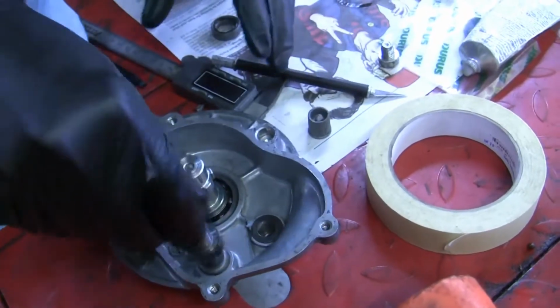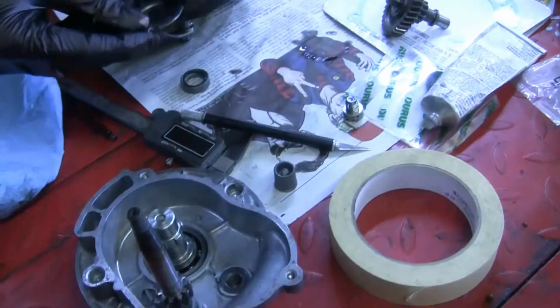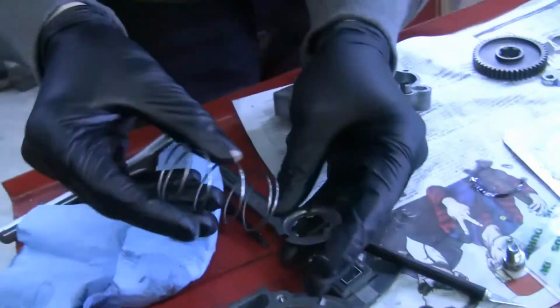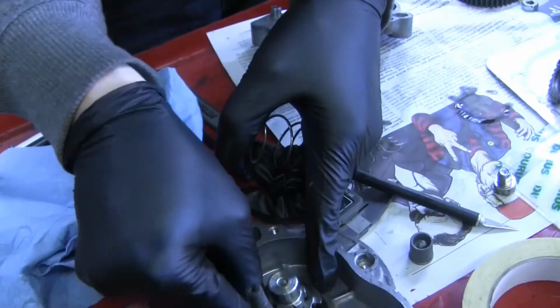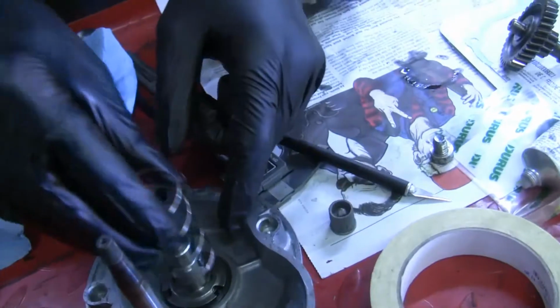You can put this shaft down here. Not much to it, it just kind of sits in there. This goes down here like this. And this is specifically so that this spring, if you can put this on here either way, it doesn't locate. It's dished like this so that it locates. So you just put that down on there like that, slides in there. And the little cutouts on that are just so it can simply go past the splines.